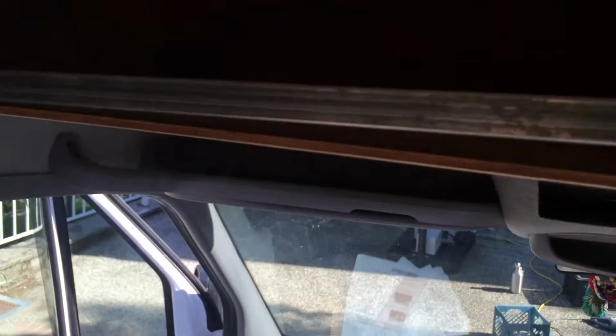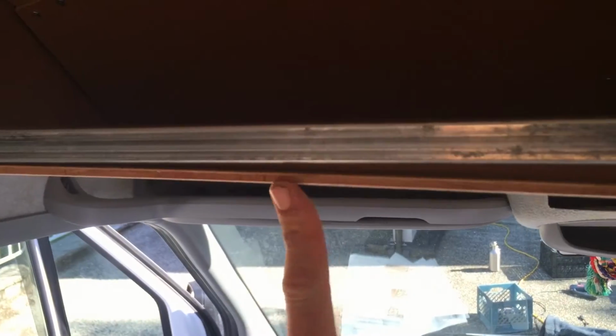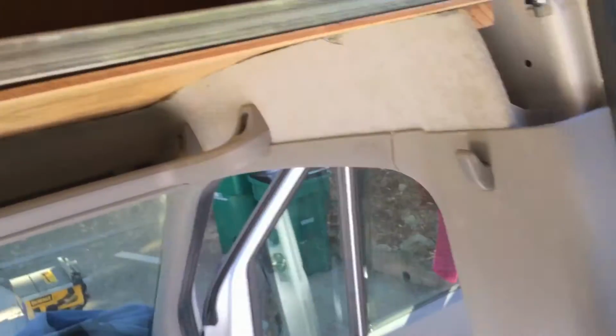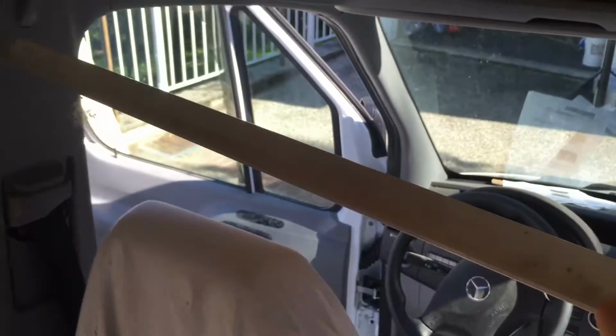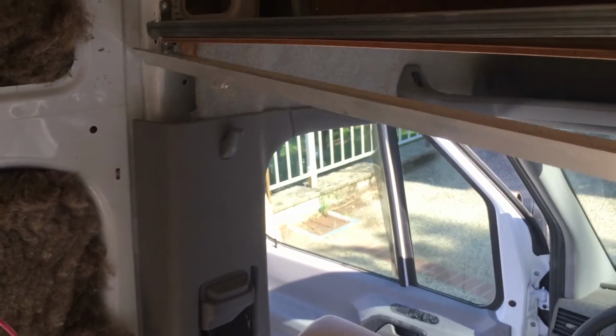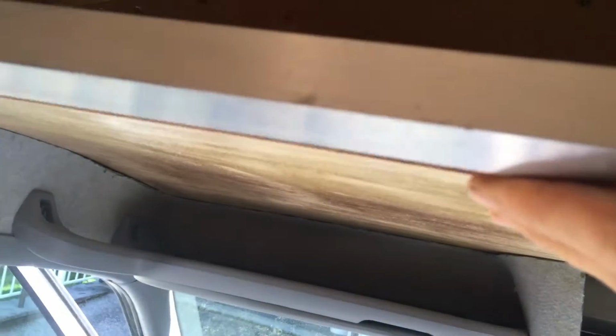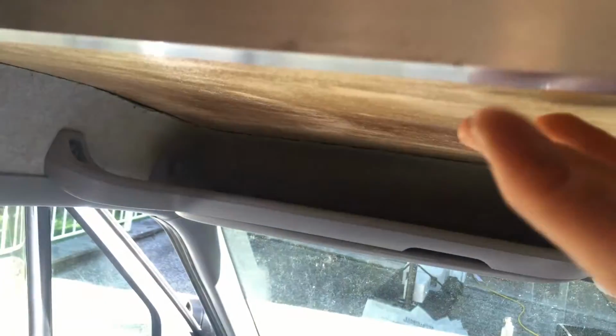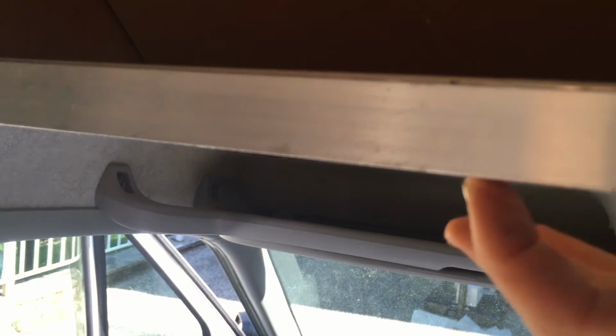And then we still say, well, hey, what about this seam right here, this edge? It's going to splinter off when you bang into that. Okay, yeah, I thought about that too. And so my solution was, I have this piece of aluminum angle iron right here, and that just fits right up like that, and that squishes the whole thing, and then that's screwed into, so now this seam is now sandwiched inside there, and then I just screw up right here through the board into this metal steel like that. And I'll probably put one right here just so nothing gets, I got insulation on me.